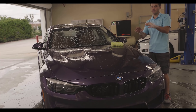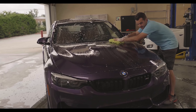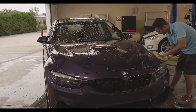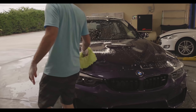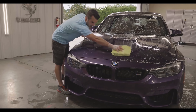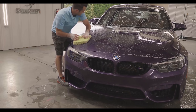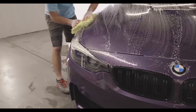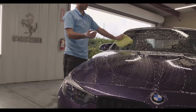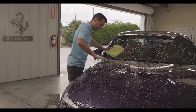How I like to wash is predominantly going to be straight lines. And it's not because working in straight lines means you don't potentially cause as much damage — it's the style of damage. Anytime you touch the paint you take chances and risks, and you do cause damage to some measure. When you wash in a straight line, your defects are more directional. Circular defects are very easy to spot. Defects in a straight line are harder to see — they're not quite as unsightly.